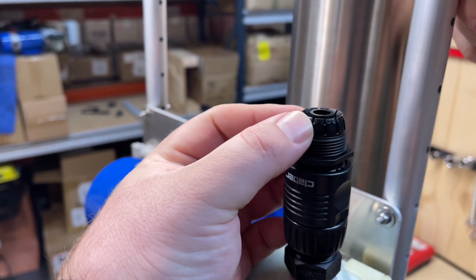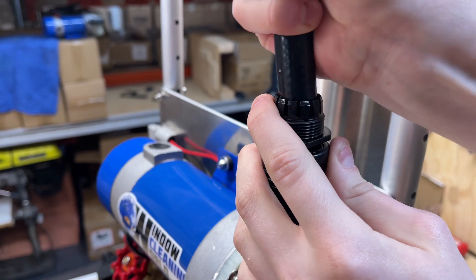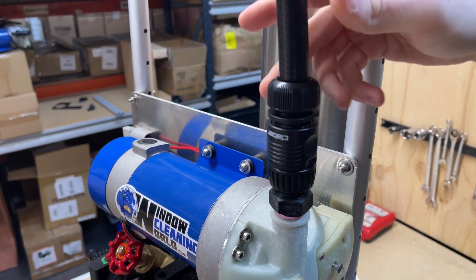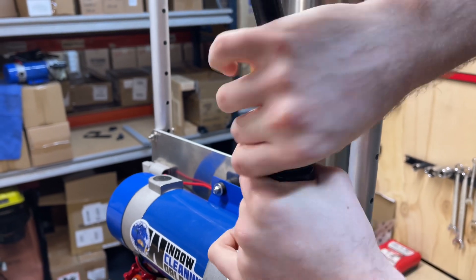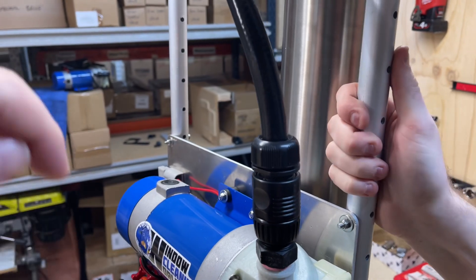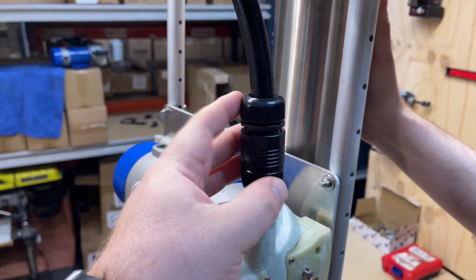See how the little teeth are a bit squashed in — what you can do is actually use the hose to spread those back out so they don't get wedged in the wrong way. Push the collar down and tighten that up. If the hose is being a little bit tight or if it's really cold, you can hold the end of the hose in some boiling water — boil the kettle and put some hot water in a mug, sit the hose in there. It'll soften the hose and make it easier to tighten the collar up.